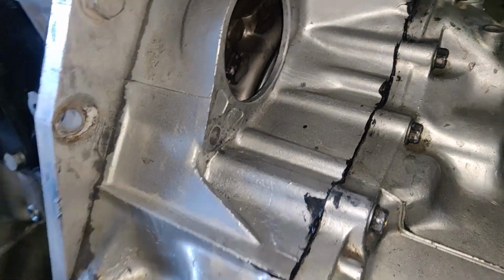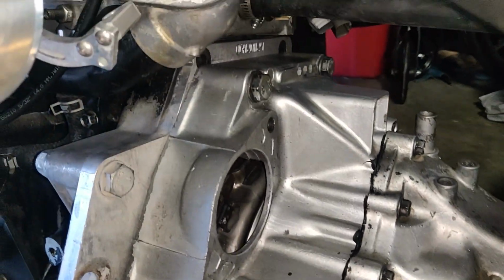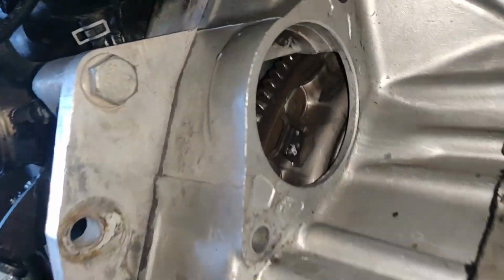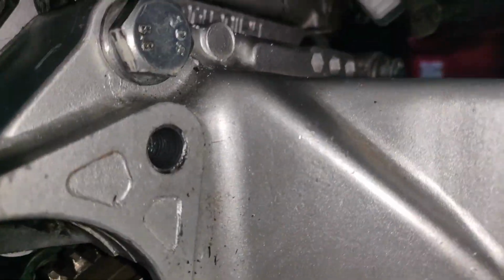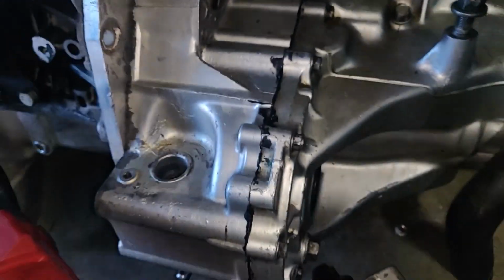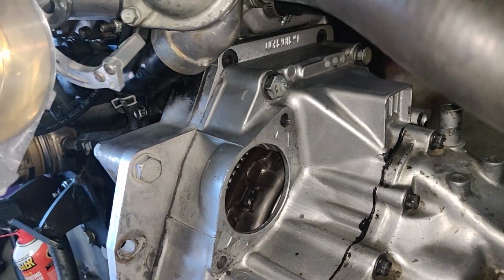Man, so I forgot that you're supposed to have the other bolt up in there already. I'm finna just have one bolt on my starter. Oh well. So I really was about to have just one bolt up in there, but I changed this bottom half of my casing, and apparently this one is like low-key stripped out until it's a little bit deeper in there, as you can kind of see. So unfortunately I can't just have one bolt on there. So I gotta take this off and put another one on there, unfortunately.